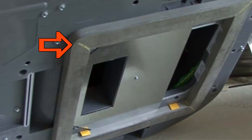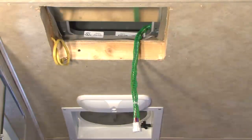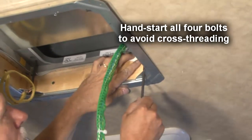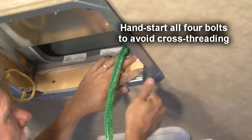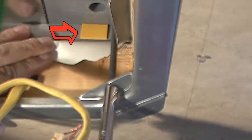Locate the air conditioner mount gasket over the 14 to 15 inch square opening in the roof. Pull the electrical conduit down from the roof air conditioner through the mounting opening and let it hang. Install the ceiling assembly mount frame using the four bolts found with the ceiling assembly. Proper tension has been achieved for each bolt when any portion of each gasket indicating tab has been pulled down even with the roof. The upper unit has now been properly installed with optimum gasket compression.